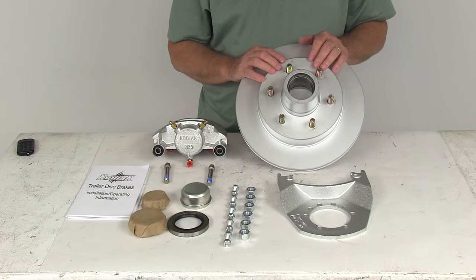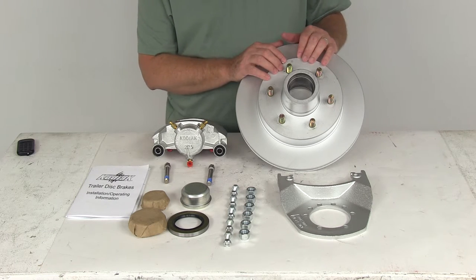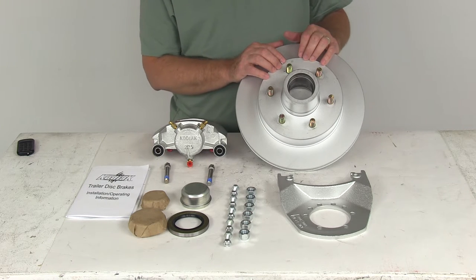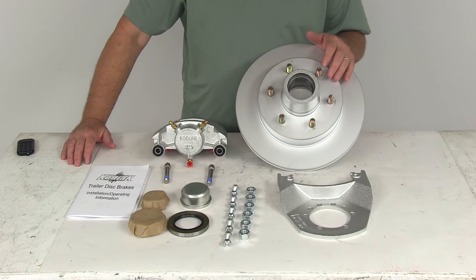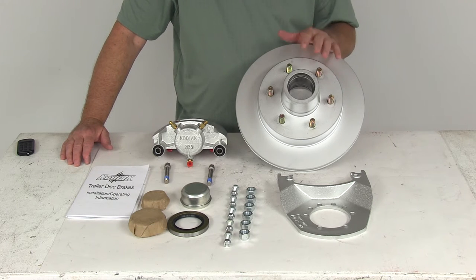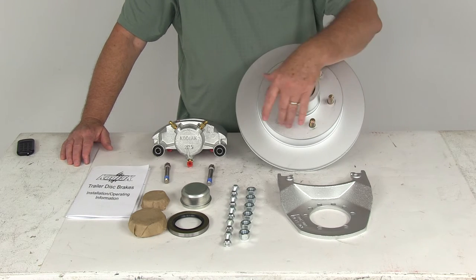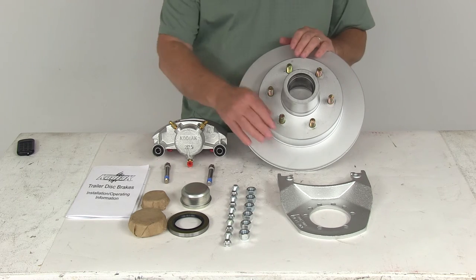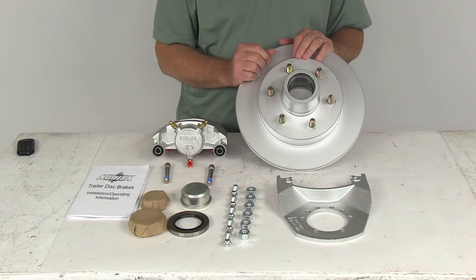The hydraulic brake actuator and brake lines are sold separately — they are required for brakes to be activated and require a PSI rating of at least 1,500 PSI. These parts are made in the USA. The specs: designed to fit 5,200 to 6,000 pound axles with a number 42 spindle, accepts wheel sizes of 15 inches and larger, bolt pattern is six on five and a half inches, rotor diameter is 12 inches, brake flange configuration is five-bolt, and wheel studs are half-inch by 20.